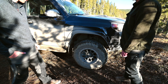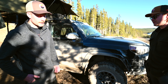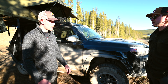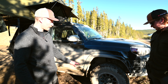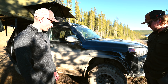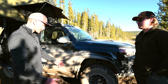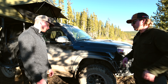The whole build was done recently, within the last month. On the wheels — the Stealth Custom Series Ray 10s — I really enjoy the look and the bullet-hole style. With my old TRD Off-Road rims I had a constant issue with tires going out of balance and constantly having to go back and get them rebalanced. If you got a little mud in those rims they'd just go way out of whack, which is no fun on the highway. These new ones are hub-centric and I haven't had a single balance issue.